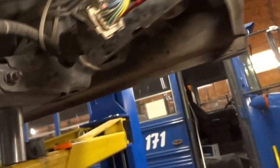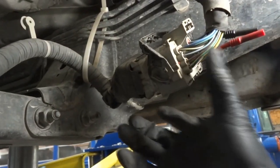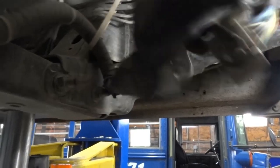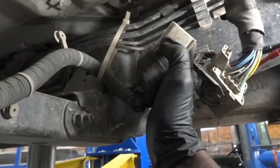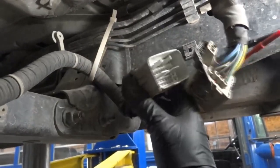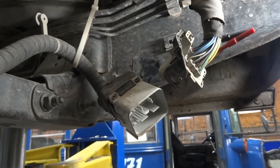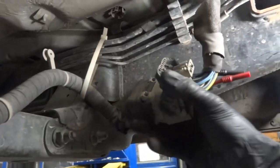What I'm going to do is remove this cover and put a zip tie on both sides, because this connector has got to be replaced — we've got to replace this harness actually. These locking tabs over here are missing. There's supposed to be a tab here and another one over here, so these two tabs are missing. Basically what's happening is when the vehicle is being driven, with the vibration it's coming out and stops making connection, then it goes into limp mode and the truck stops.